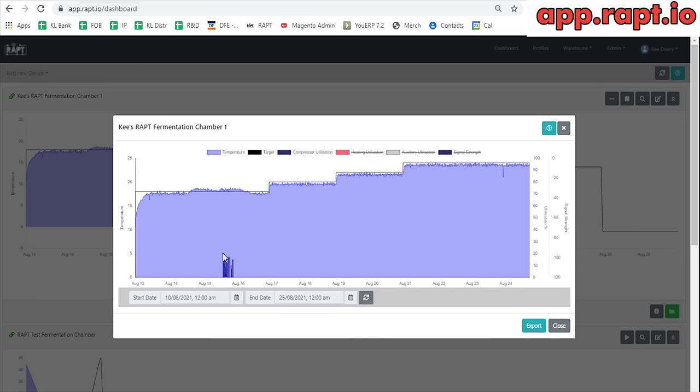What I can see here is it wasn't cooling much — it's the middle of winter in Melbourne, so the compressor is hardly turning on, with overnight temperatures dropping sub-10 degrees Celsius. For one day the compressor was at about 20% duty cycle, which is nothing to be alarmed at. However, if I saw it peak at 100%, that would be a good alarm that my compressor is on a lot and I might need to look at improving ventilation — maybe I've left the fridge door open or the fermenter is pushing against the door.